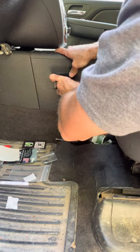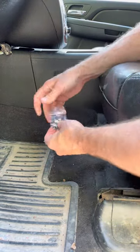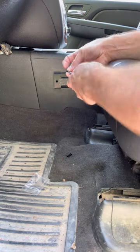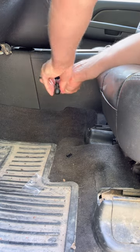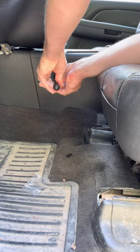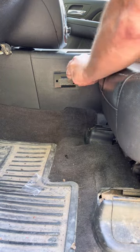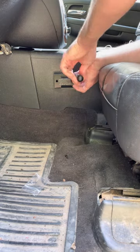Next we're going to let it sit for a full day — do not touch it. The next day, come back and install the three number six pan head screws inside the screw holes. These screws are very small, so if you're worried about a gaping hole in your mounting surface, it's really a non-issue. You don't need to use them, but if you choose not to, you have to make sure the surface is very very clean, or the tape will fail.